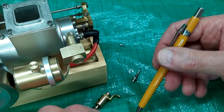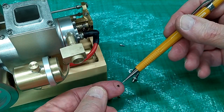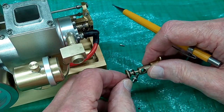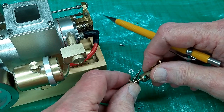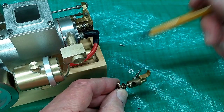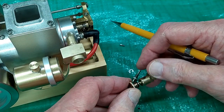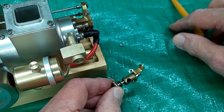When I took it apart, I found a couple of little pieces of rubber in there. That's typically flashing that came off the O-ring — a lot of times there are burrs in here, and when they push it together it will slice a little layer of rubber off. I think that rubber was in here working somewhat like a check valve, and hopefully when I put it back together it will run better.